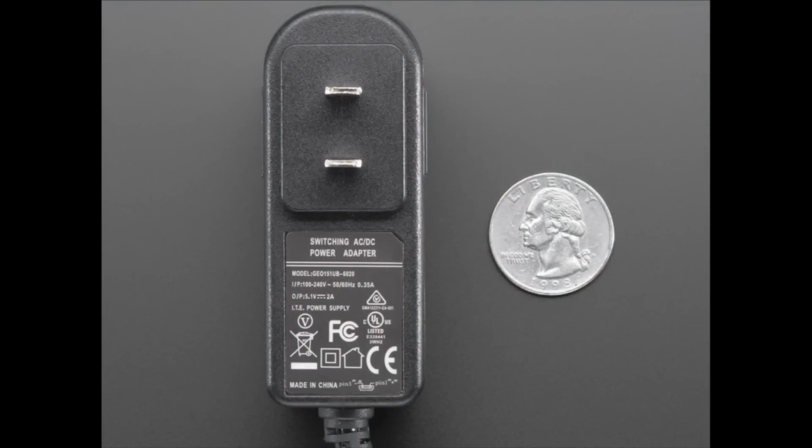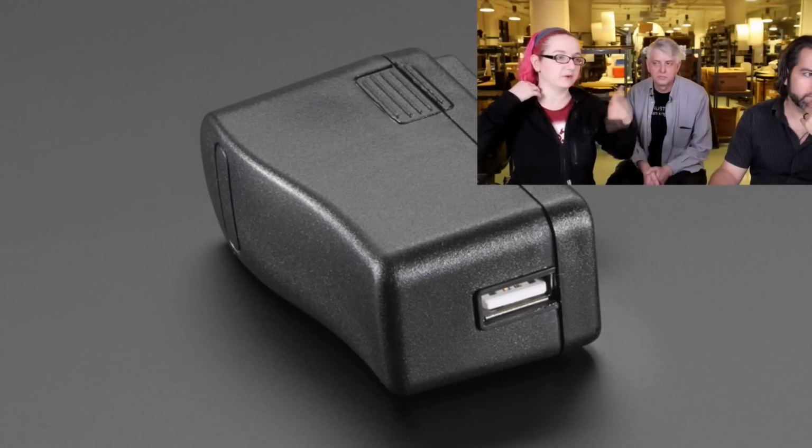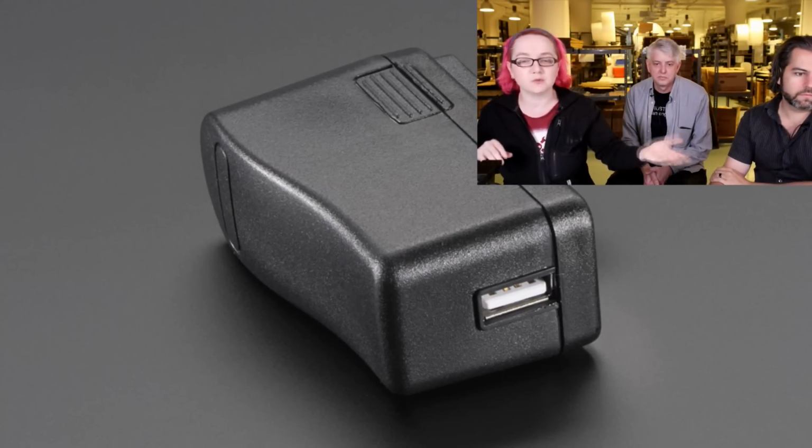One, can you go back to, has a USB port. And you can plug in, it has iPhone resistors, quote unquote, iOS resistors. So you can plug in a tablet and it'll charge at 2 amps, or an iPhone and it'll charge at like an amp or whatever. So you can do that. You can use any USB cable you want.